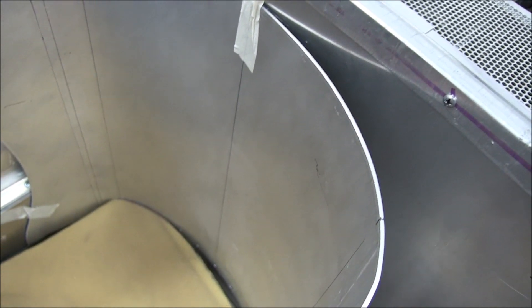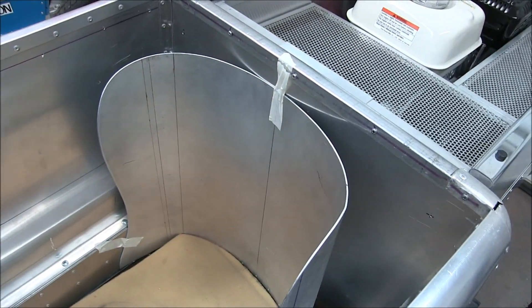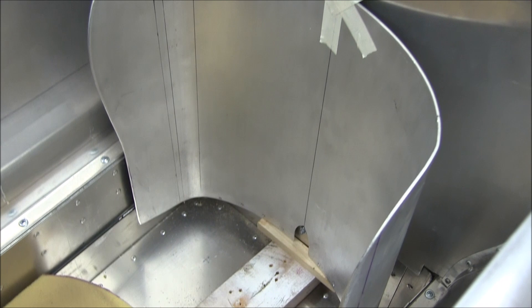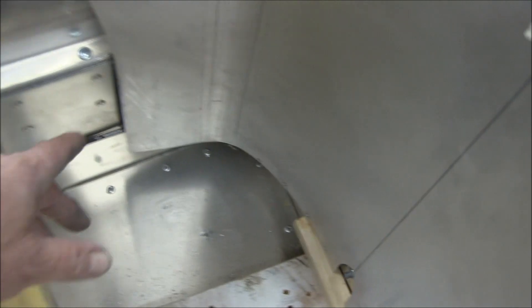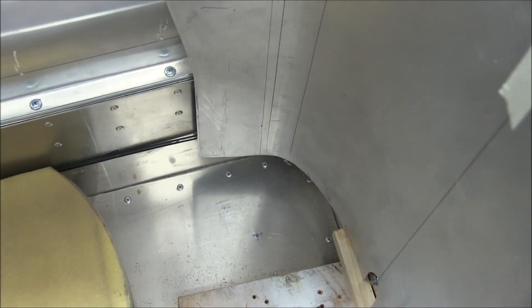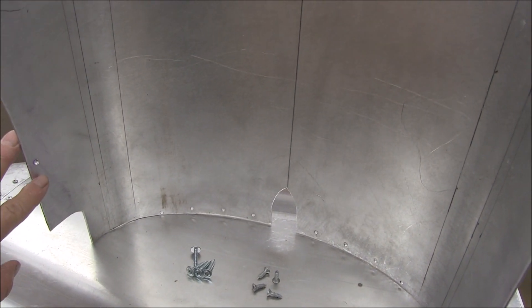I'll splay these out considerably and I might even drill some holes in here just for looks. I'm making progress — I trimmed it here and over here and made a notch for this bolt that comes through. I think that's the height I'm going to go with. I need to shape this just a little bit so it'll lay flat and get around this throttle cable, and then I can attach it. I made a little notch here, drilled the holes for the screws that go into the chassis, and I'm going to put a row of screws — these are like a number eight sheet metal screw, they'll be flush.